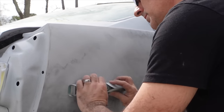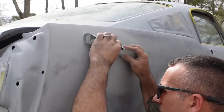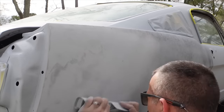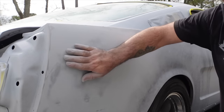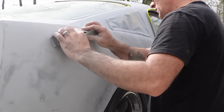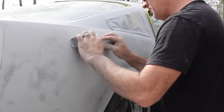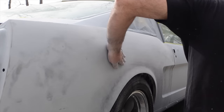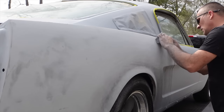This takes a lot of time — don't get frustrated. This can be therapeutic; put on some good music, get out here and block sand your car. You can just kind of lose yourself in it. Even if your body work is not perfect, if you're able to come in and block sand you're going to see such a huge difference. I recommend you work your way around one panel or half panel at a time, then run your hand over the panel — close your eyes and see if you feel anything.